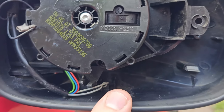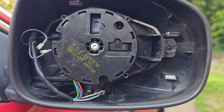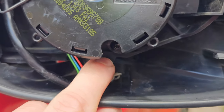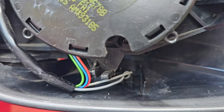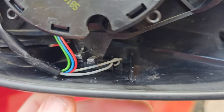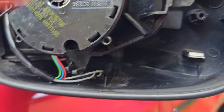That's when you start getting problems with your climate control and your aircon not working. Rather than film it all again, I'm going to add the video for the mirror cover that I did. I've already popped the glass out and undone the three screws around the side to get this loose enough, because this bit here holds the temperature sensor down. You have to get this loose enough just so you can get in there and pop it out. Now I'm going to get the tripod set up and do some soldering.